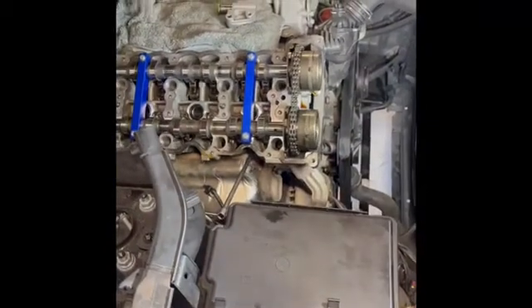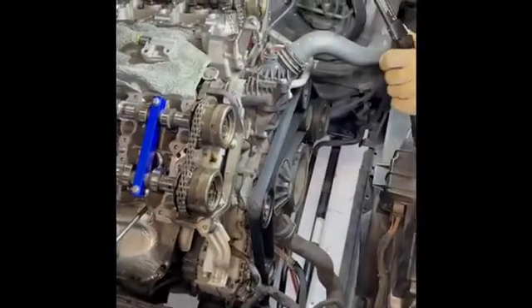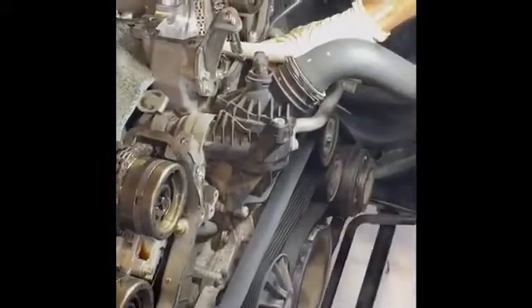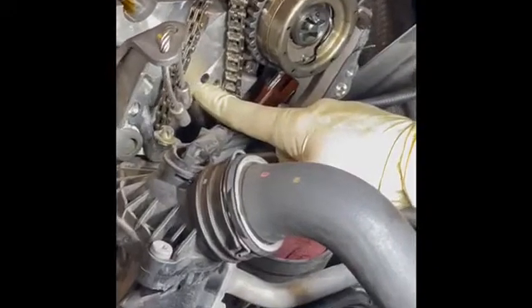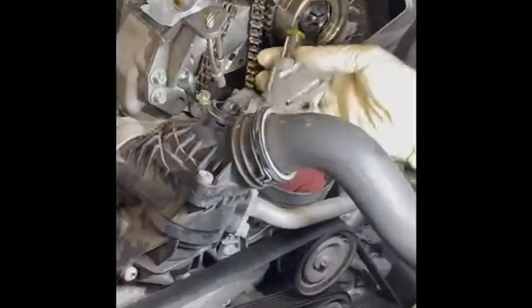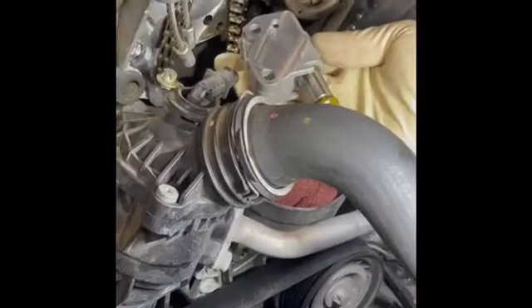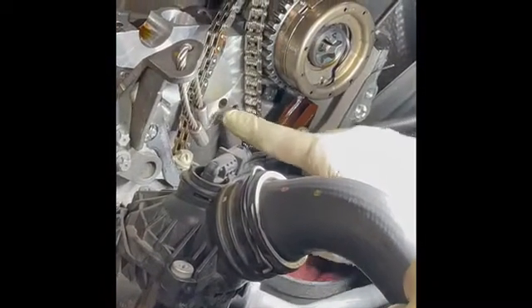On this specific car we're replacing a timing chain, and it also has a complaint for a rattling noise. The rattling noise comes from a missing check valve in this hole. I will put the part number in the description — you can get that check valve from Mercedes-Benz. This is where the tensioner goes, and this hole is the oil supply hole for the chain tensioner. Because this valve is missing, the system loses oil pressure and causes the rattling noise. By putting a one-way valve here and pressing it in flush with the cylinder head, that will take care of the rattling noise.